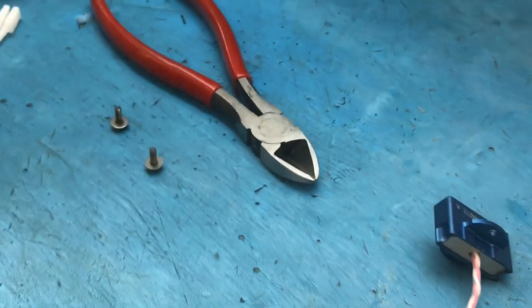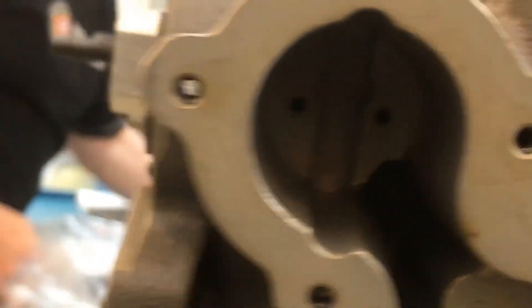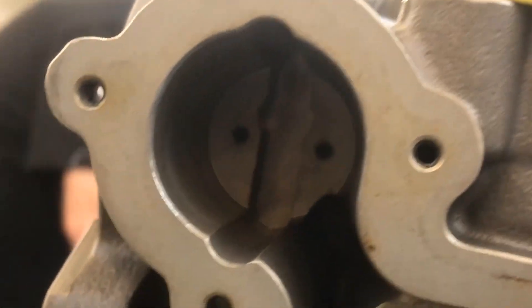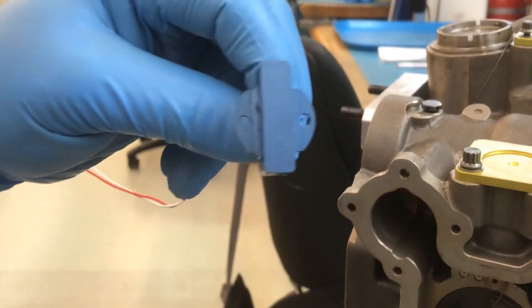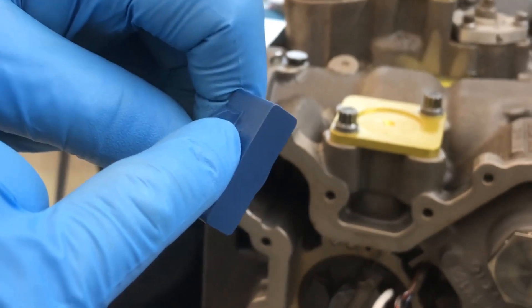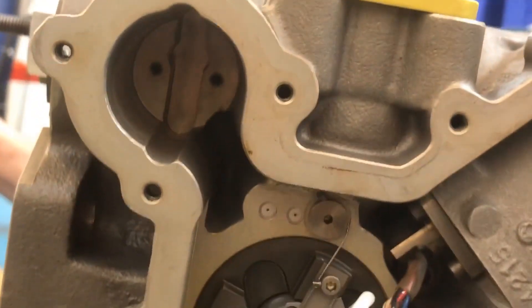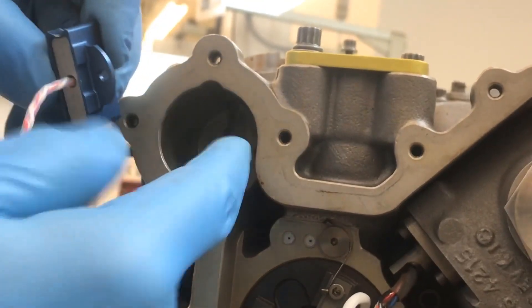The switch may come out easily by simply pulling on the wires going into the switch. Note the body cavity notch in the AFSO switch cavity in the HMU housing that lines up with the locating rib on the removed AFSO switch. This will be used to properly install the new AFSO switch. Misalignment of the locating rib will prevent proper installation of the AFSO switch.